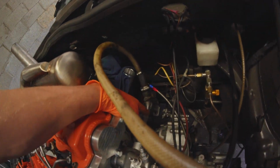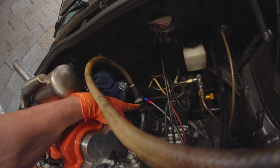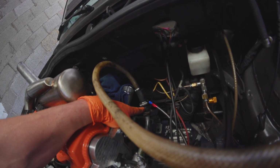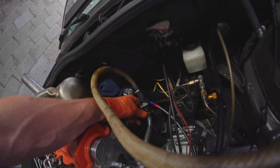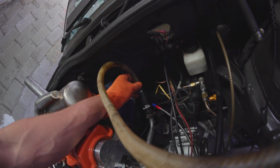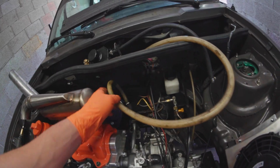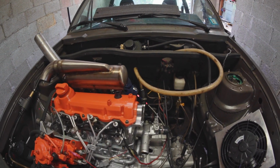So this metal pipe right here, that's ALH parts. This right here is actually the coolant fill slash return slash feed to the pump from the 1.6, which necks from the ALH size down to the tube size that I will be feeding with, actually quite nicely. And then this will just need shortened, obviously, to get it to sit up here nice. That's the thought. Okay, I'm back.